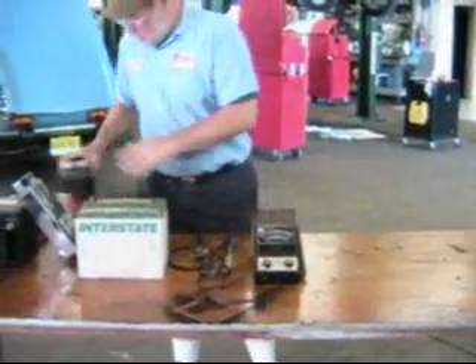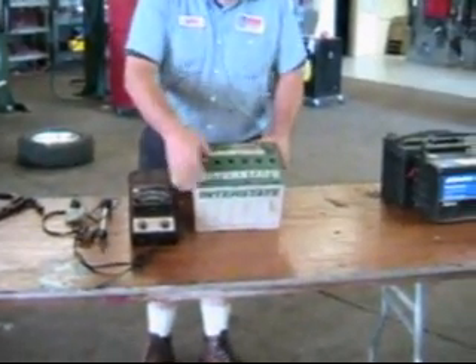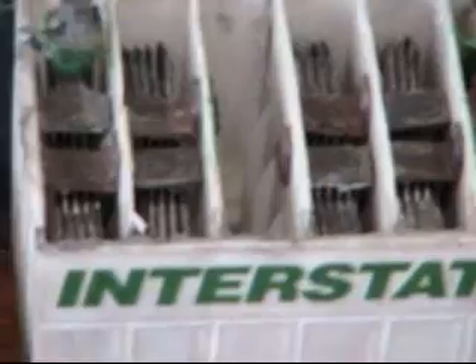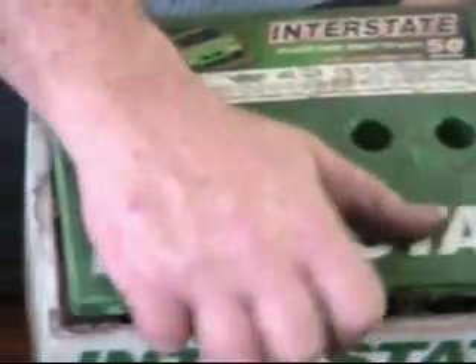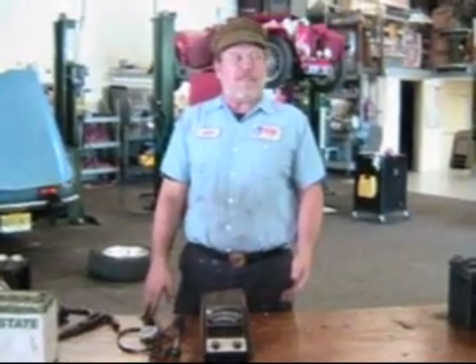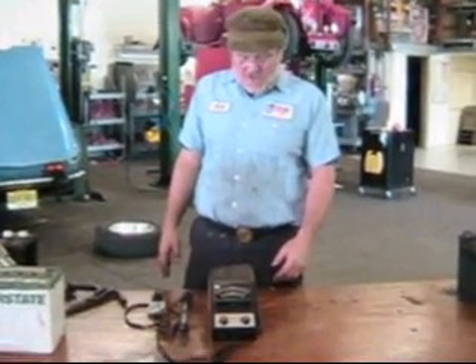If you come to our technical seminars, you can look at this stuff more carefully. Here we've got a 12-volt battery, more like a group 24 battery that would be in your car. I took the top off this one, and you can see that down inside here connections are made on the inside. The number of plates on the inside determines how much electricity this battery will hold. They'll hold about 80 amp-hours, meaning they will deliver 80 amps for one hour, or one amp for 80 hours. It's an enormous amount of energy.